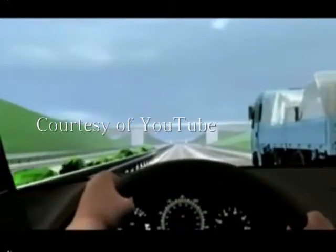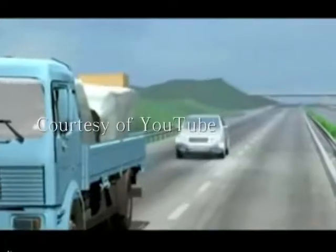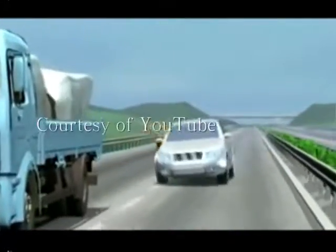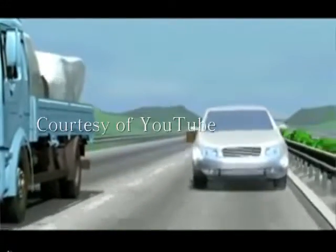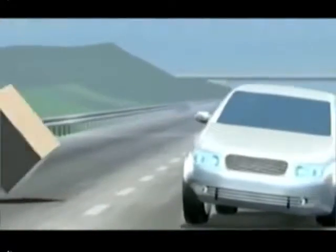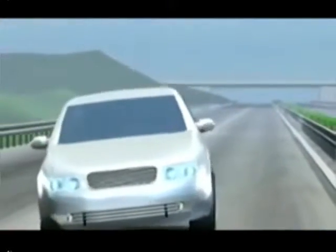In everyday driving, it's normal for transverse forces to arise. But when you drive a bit too fast or turn the steering wheel, these forces can negatively affect road holding. But the Electronic Stability Program ESP nips that in the bud by controlling the brakes, if necessary the engine, and if need be the transmission as well.